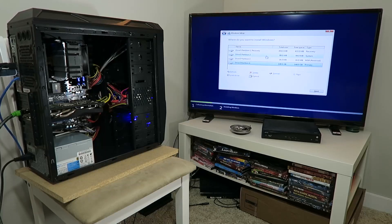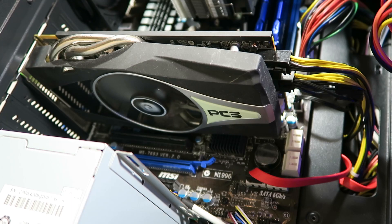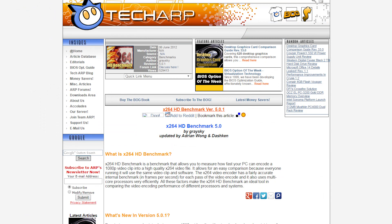It booted up with no issues and I proceeded to install Windows 10 and the necessary drivers. I forgot to grab a screen capture of the MSI Afterburner settings, but I barely touched it — the PowerColor 7870 comes clocked at 1100 MHz out of the box and I ran all benchmarks at 1133 MHz, so that's only 3% which is almost negligible. Unfortunately I didn't run as many tests as I'd have liked to showcase the 8320's video editing and rendering capabilities. The only CPU benchmark I ran was Cinebench R15 — I really should have done a Handbrake test and an x264 HD run as well. I'll have a link below to Nont.tech where you can compare the 8320 alongside a similarly priced Intel CPU. Just sit back, relax, and enjoy the benchmarks.